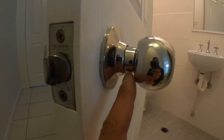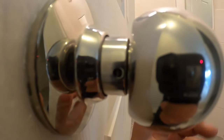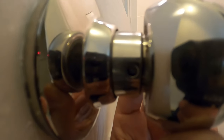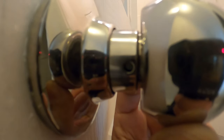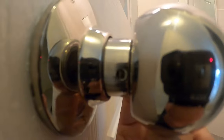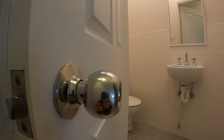Now the little trick has to do with this little hole right here. If I zoom in and get a good angle for you guys, you can see right in that hole — as I turn the knob — there is actually a little pin inside. So at the moment you can't see that pin, but if I turn it back over you can see there's a little pin inside, and that pin is going to release this doorknob right here.